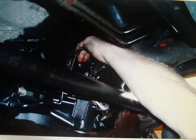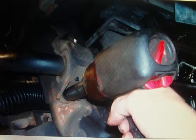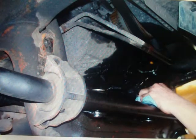And we're doing some more with the hoses, and you'll be spending a little bit of time in there. You can see we've just got the lines laying loose there. And guess what? We're coming close. Next we take off the sway bar, 2 bolts on each side, because this has got to be moved to allow you room to take out the power steering rack. So we just let it hang, just undo the 2 bolts on each side on the frame for your sway bar, and it'll fall out of the way. You can see it's dropped a bit.